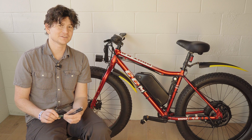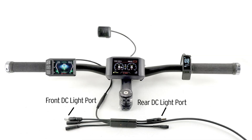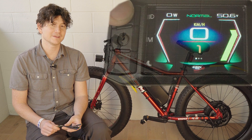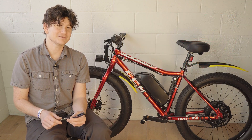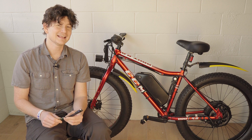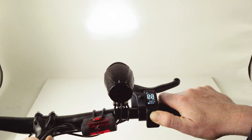The second core function this Super Harness brings to the table is bicycle lighting control. Most of these displays have the option to turn bike lights on or off by pressing and holding the up button. The Super Harness is able to sniff the communication going on between the display and the controller, sense when it's telling the system to turn on the lights, and actively switch on its own front light port.